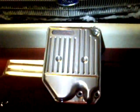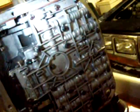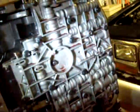I've got it tipped up and the transmission pan off. I had a little more fluid than I thought, but that's alright — I've got a nice drain pan there. Next step is to take this transmission filter off, and then take the valve body off. I'm going to start by taking off the eight shorter bolts, then all the rest of the bolts which are a little bit longer. I'll get that done, pull this off, and set it aside.